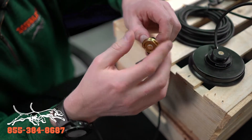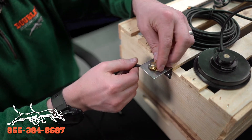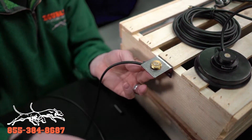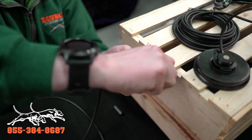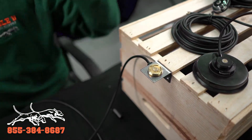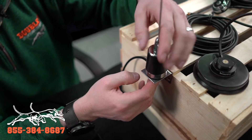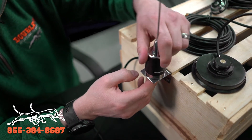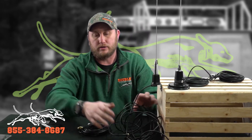If you watch, you unscrew the top part of the cable until you get two pieces. Mount it up, and once you get the mount mounted on top, you can then put your antenna on the mount and it just screws on. After you've got your antenna set up on your pickup truck, now you can run your cable. It's really important that you don't run the cable first — you want to hook it up to your antenna and then run it through your firewall and hook it up to where your radio will go.